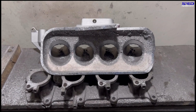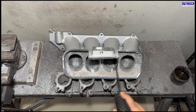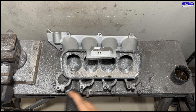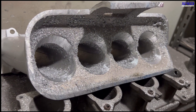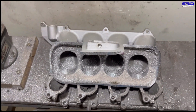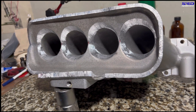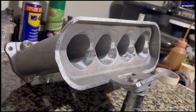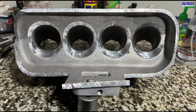Here is the other side — not yet touched — so we're going to work on this. Both sides of the opening have been improved quite a bit. Now looking closer, the expansion of the entry is getting there — it's almost there. It's opening better than stock. Now it's starting to look like a velocity stack, which is going to be way more efficient as far as airspeed goes, giving it more efficiency, power, and torque. Here you can see the stock form versus the ported one.